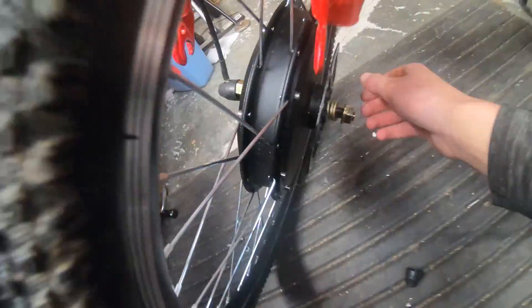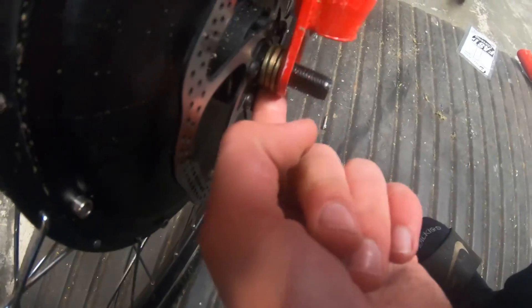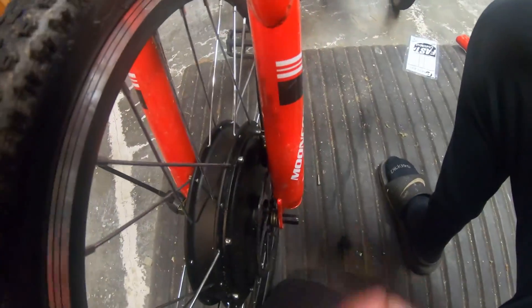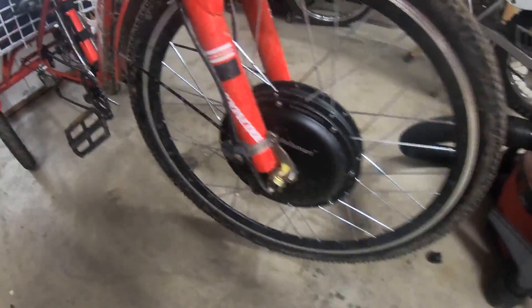It really helps to have the bike upside down, but since I've already test-fitted it we're not going to do that now. The part that's going to be different for everyone is the washers. On this side I've got three washers, and that's so there's enough room for the disc brake — you can see there's a super tight tolerance on this thing. On the other side I'm not using any washers because we're using three over here. That's how big the forks are.